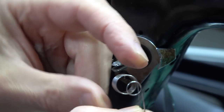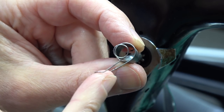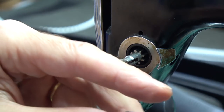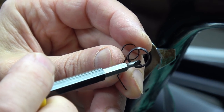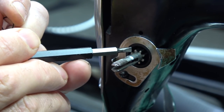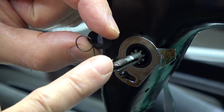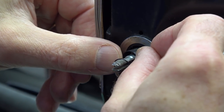This one doesn't look too bad but it's just lost its bounce back — it's bouncing, just not as much as a new one. Otherwise it looks quite good. So take your replacement spring — you'll see on the inside the end of the spring curls inward with a little ledge. That actually sits on the cog tooth, and the best position for this spring when reinstalling is to have the springy arm pointing downwards.